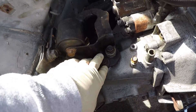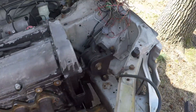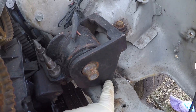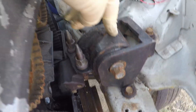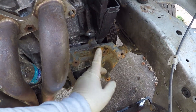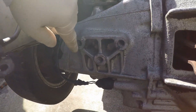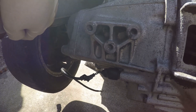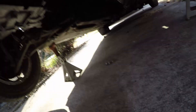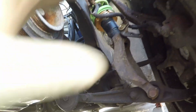You've also got your transmission bracket. This right here is the transmission bracket. These mounts come with the mount kit — the T bracket, transmission bracket, and the driver's side engine mount bracket. These are the brackets you need; the mounts come as a kit — one, two in the back, and then the third one. This other mount here, the AC power steering bracket, has a pin that goes for a subframe mount. There's supposed to be another one right here too — it bolts into the transmission and mounts to the subframe as well. Those two front additional mounts actually help a lot — keeping the car handling better, helping the engine from moving so much, and helping keep your wheels stabilized.